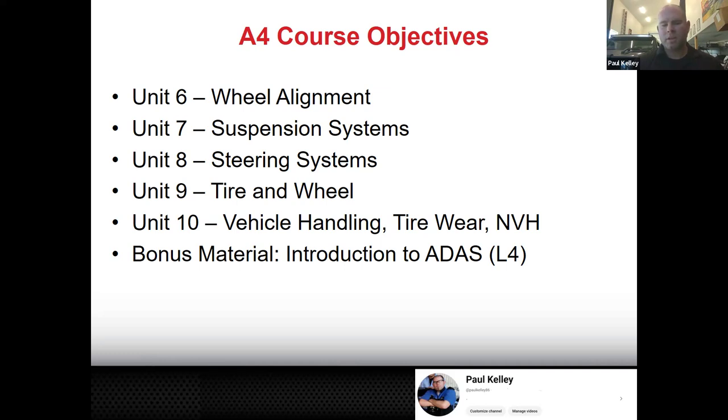So the recommendations here in Southern California may vary season to season. So being that we're in our rainy season, and you can see we got like over an inch of rain forecasted for tomorrow, my recommendation on a car today may be a little bit more conservative, saying, hey, you know, you have 3/32 left on your tires. That's legal. However, tomorrow and all that rain on those freeways, it's going to be rough. You see, so unit nine is not simply, oh, tires, they're round and they're black and they hold air. There's a little bit more we're going to go into on that. So we got a whole unit on that.